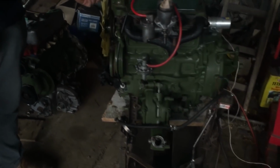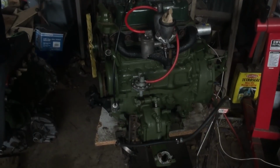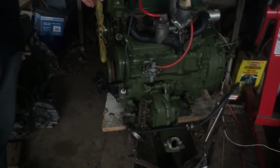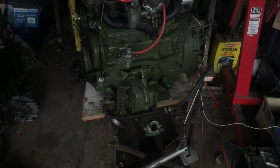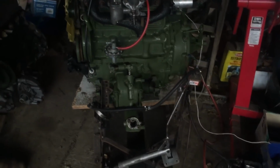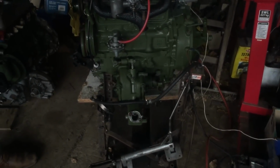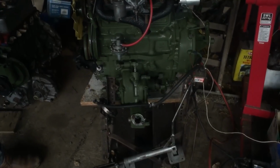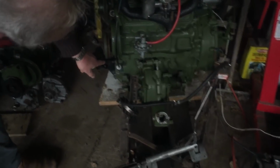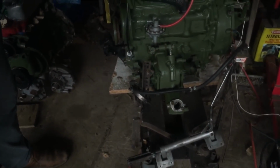It'd be worthwhile, if you know what I mean. Definitely. So you need a fan belt, depending on what you're going to fit. Yeah. A dynamo or alternator. I was looking for some alternator brackets, but you can buy brand new ones, but they're like 20 quid for a bent bit of metal, so I'll keep an eye out for a second hand one. Well, there is one on that 1300, but you'll need that on there. I didn't know if they were slightly different between the 1300s and the small blocks, position-wise. There may be. Well, the later blocks, they moved the bosses, didn't they? Yeah. And this is an old type mounting that came off that 850, and I've just had to cut it a bit to get the fan belt, because I fitted a damper on it. Ah, okay. It's always best to have a damper on them.